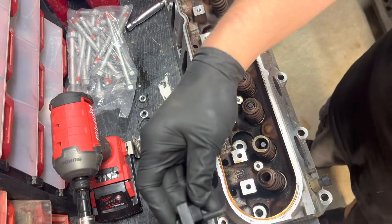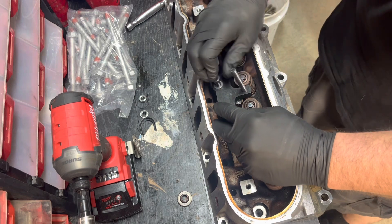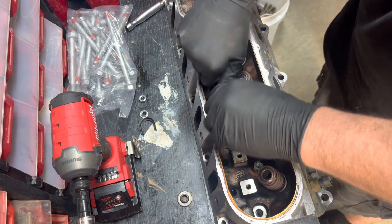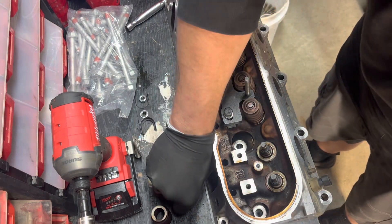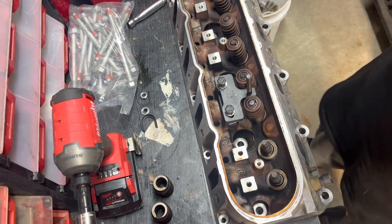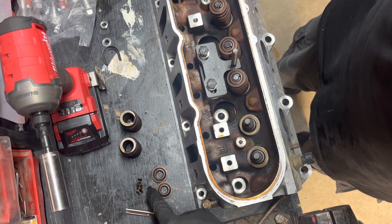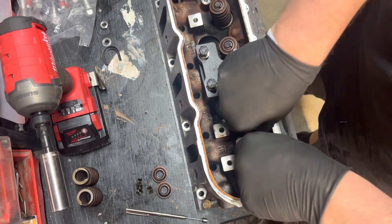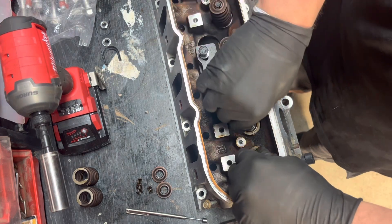Let's get this put in place so I can show you exactly. You can hold that in place — both washers. We'll go to the next set right now; we'll do it. This is prerecorded, obviously. So if you're doing this for the first time, like myself, this is a very important step. Those keepers are going to be reused. These springs are going bye-bye. We're going to change these two seats out — I think I can potentially pull them out; maybe some WD-40, and get a pair of pliers on exhaust and intake valves.